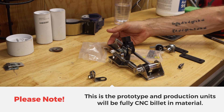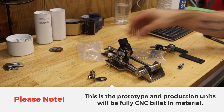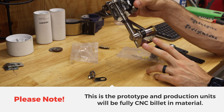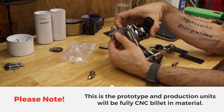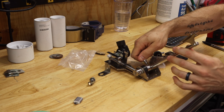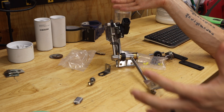When you receive this from us it will look something like this. We designed it so you can independently rotate this arm to position it, making it a little cheaper to ship. It comes with the fully assembled pedal setup. This is a bracket that mounts right where your original factory pedal goes — two bolts down here, plus a supplementary connection on the left side that connects to an existing hole on your Mini's body. These three bolts stabilize and hold the new electronic pedal. There's a set screw to help position the pedal, and it'll look something like this when installed.